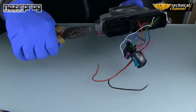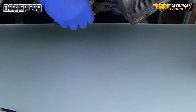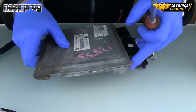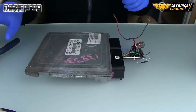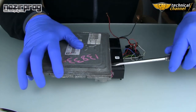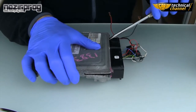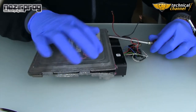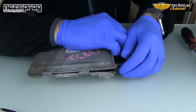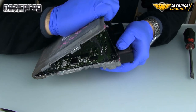You no longer have to buy expensive tools to read CS and MAC addresses in your ECUs. You don't need to know them. The only thing you have to do is read the ECU's SPI 95320 memory content, change the content according to the description in our manual, solder the J2, J3, J5 and J6 jumpers, and connect the emulator.